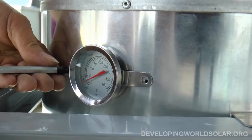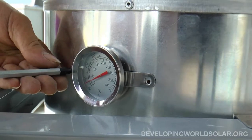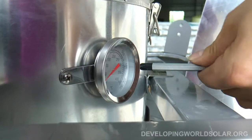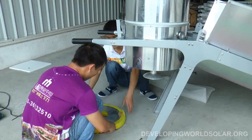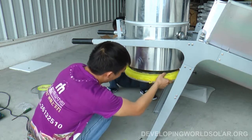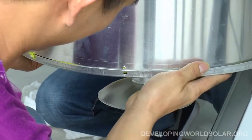The thermometer may now be inserted through the outside of the cook box in holes provided for fastening screws. The bottom cover including the insulation should now be reinstalled using the original screws in the holes provided.